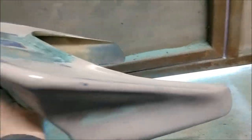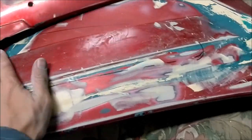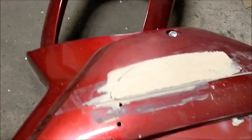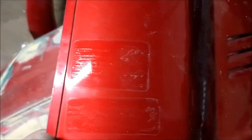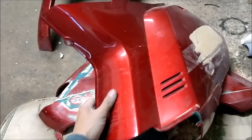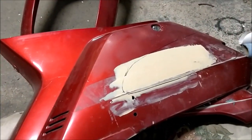I've just been doing a bit of sanding on the spoiler — it's going pretty well, smoothing out quite nicely and looking pretty good. Just need a bit of spotting filler over the top to fill in all the little gaps, then another quick key up and sand up and that should be ready for paint. I've been taking all the stickers off the side using the heat gun — give these a good sand and key up ready for paint soon. Not too far away from paint now, exciting stuff.